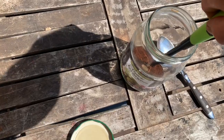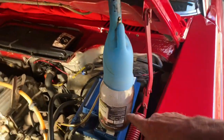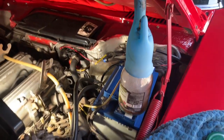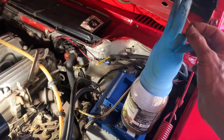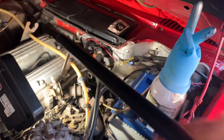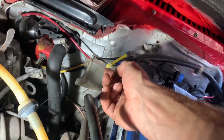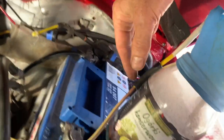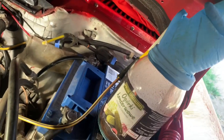Let's see what happens when we light that — and that's starting to create quite a bit of smoke. All this is is some fresh coffee in there, lit with a standard cigarette lighter or oven lighter. What we've done is taped in a standard valve from one of these bicycle pumps — a few pounds from the bicycle shop. We've taken the vacuum line out and put an old bit of vacuum line in, just sealed it with some hot glue so that's now sealed.